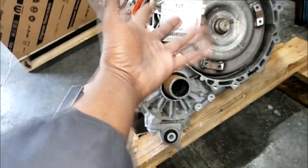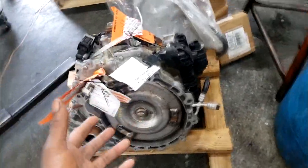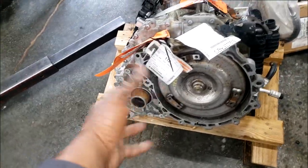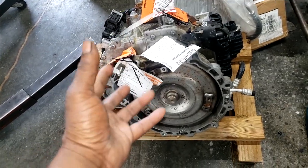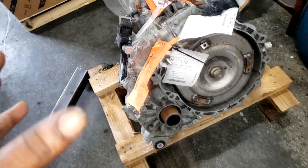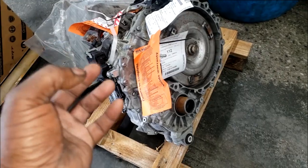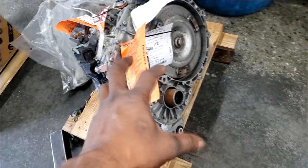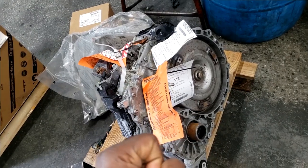Now this is a typical 948TE 9-speed ZF front wheel drive transmission. Nothing to run home about. But because of this suspension housing, that tells me that it's an all-wheel drive unit. PTU, all-wheel drive, right? But that car is small already, right? Now, imagine you got a PTU attached to this, and this attached to the car, everything else. You talk about a tight fit.